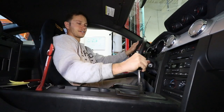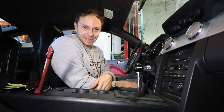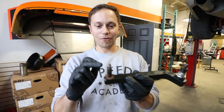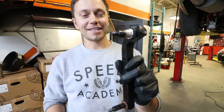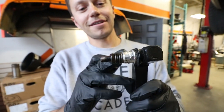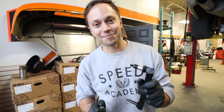I already like it a thousand times better than the factory one, even though it's not hooked up yet. Speaking of which — bad news: we cannot find these shifter bushings online at all. Steeda makes a set for the shift lever side but not the transmission side. So I've jerry-rigged it with some aluminum tape wrapped around for the time being, until we find a proper solution. The Hangar Garage guys would probably be happy with me.